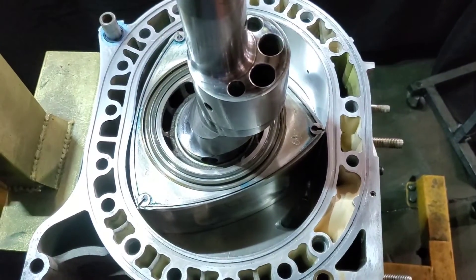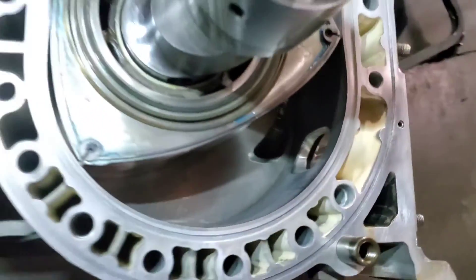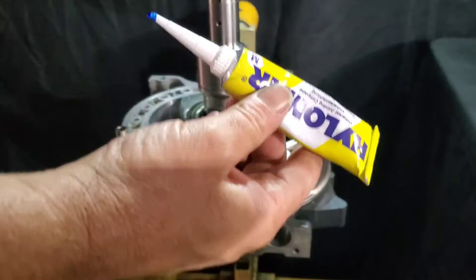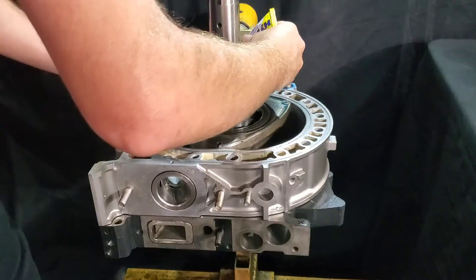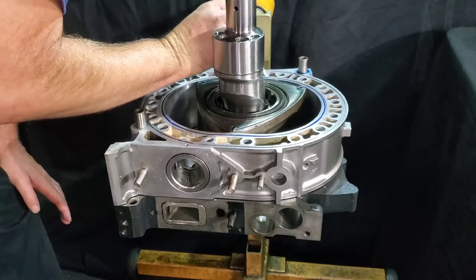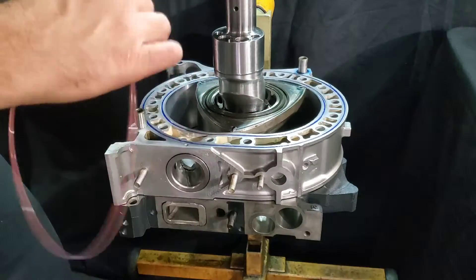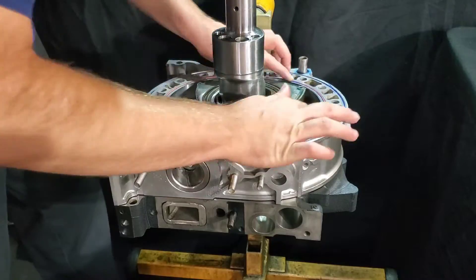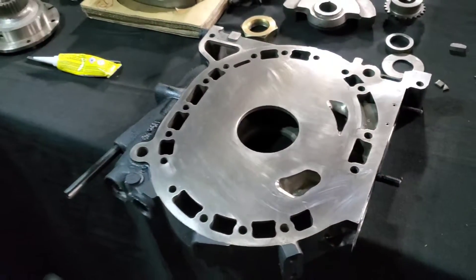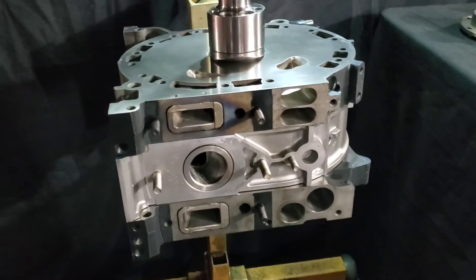I don't want to rotate it too much, but I do like to orientate the motor a specific way that allows me to look at things and bring the center plate down in easily. I'm now installing the next set of water O-rings — a little Hylamar, drop them down in. I don't like to do them all and then put the rotor in while it's oily. I'll wipe the open face down and then apply the Hylamar and get those O-rings in, ensuring that I don't contaminate any of my sealing area with any oil, fingerprints, or anything like that. We want a nice, dry, clean surface for the water O-rings and the Hylamar to seal against.